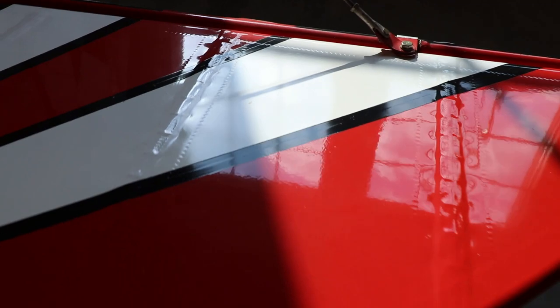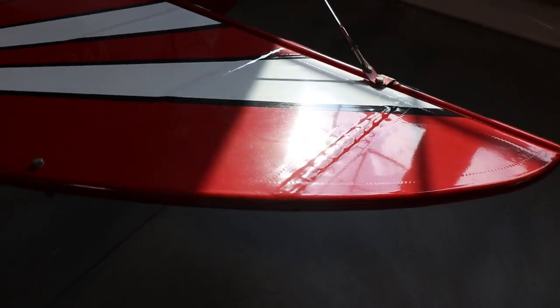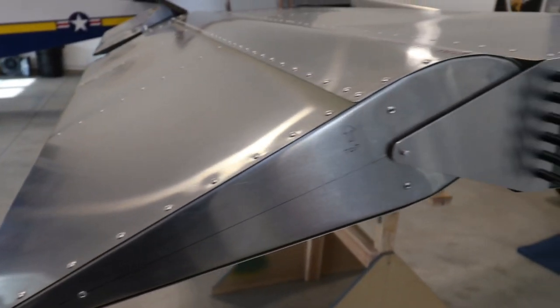There are a lot of skills that a builder will need in order to finish an airplane. For example, if you're building a tube and fabric airplane, some of the skills you'll need are fabric covering, paint edge tape, and how to properly apply the fabric. If you're building an aluminum airplane, you're making small brackets, drilling holes, and finishing edges — all relatively simple skills. But I think the number one skill required to build an airplane is the ability to think ahead and picture the airplane as a whole, not just the parts you're working on.